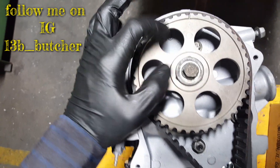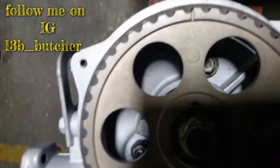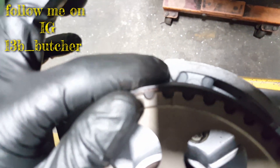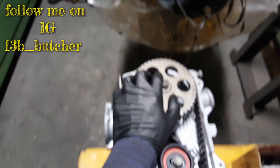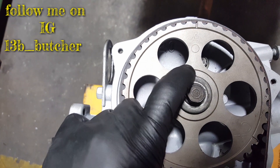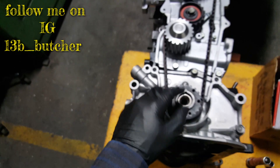The pin for the camshaft can match on any of those grooves, but your timing is going to be in the A. The camshaft pin should be on the A groove. Make sure you put it in there so the pin is on the hole right on the A. The timing mark is the triangle in there, and the little groove lines up there. Make sure the pin on the camshaft and the groove are on the A, pointing up — it has three grooves: one, two, and the third one right there.